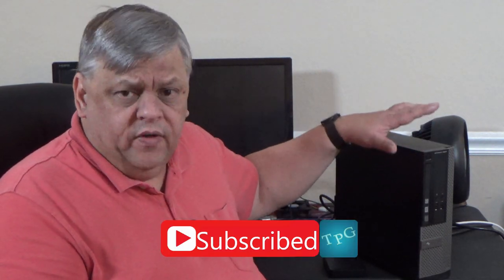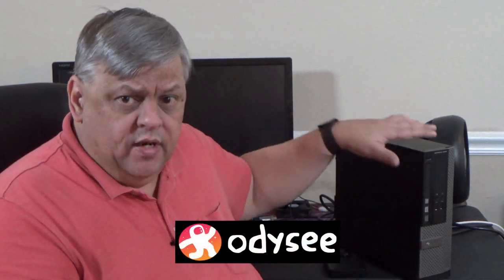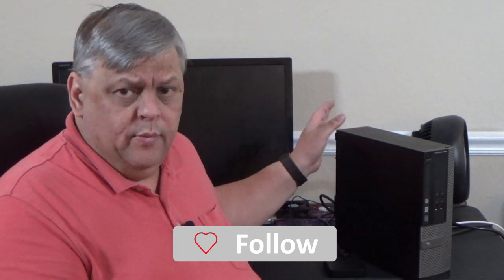Obviously the graphics on here aren't meant for gaming, but we wanted to see if we could turn it into a gaming PC. One challenge was it had no HDMI port, so we had to find a solution beyond standard VGA. We've tried it with a GT730 and currently a GT1030. That 1030 is about the same graphics quality as a modern Ryzen 5600G APU — on 900p or 720p low settings you can get 30fps or better, and something like CS:GO runs over 90fps.